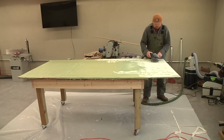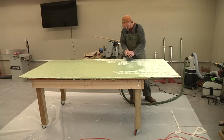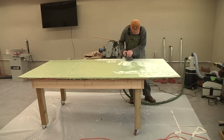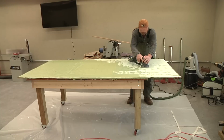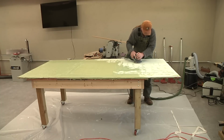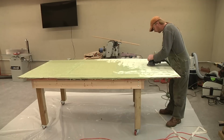inverted situations. So after that first round of fairing compound was applied, I let that set up for maybe 20-30 minutes just so that it wasn't quite so squishy, I guess, for lack of better words. And then after that was somewhat set, then I came back in and actually started laying the fairing compound over top of the three main sections that were fiberglass.